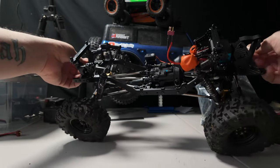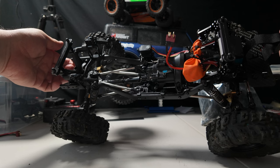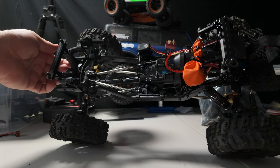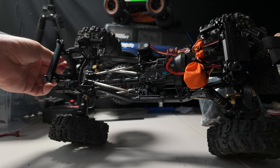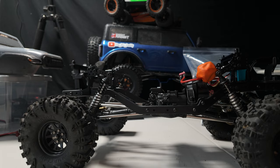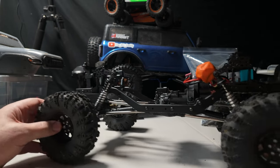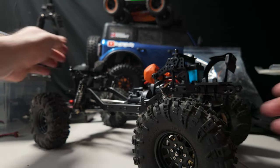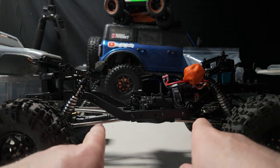Like, with those Enduro inserts in there holding the sidewalls, the side hill on this thing, look at it. It hasn't unloaded yet. There, that's the tipping point there. Look at that, guys. Anyway, if you want any sort of side hill performance, you're going to need to keep your ride height low. And ideally, at running height, you want your links level.